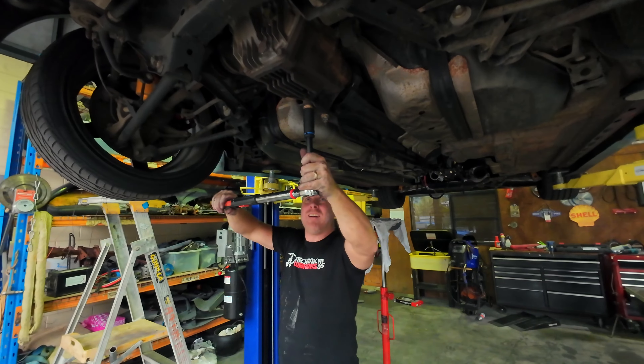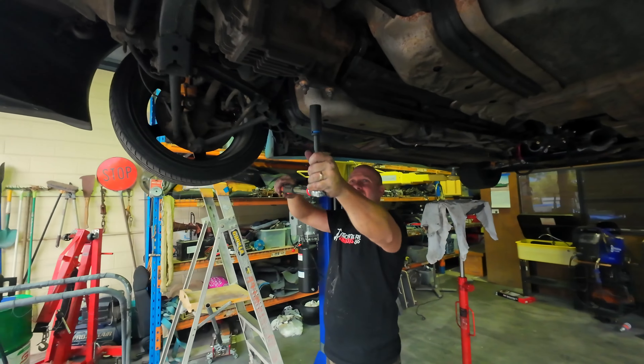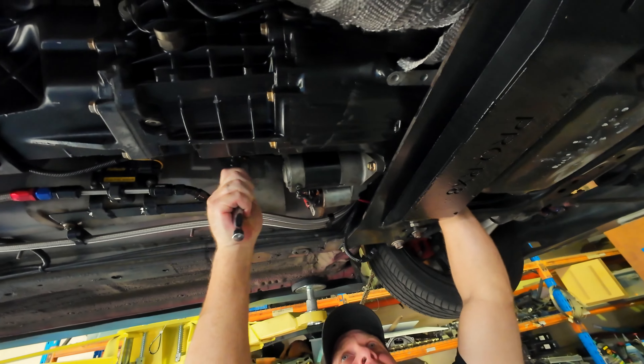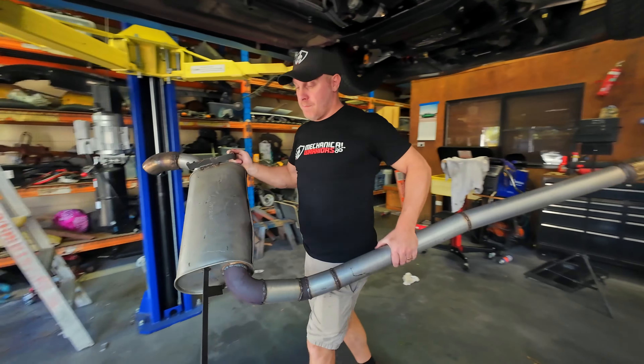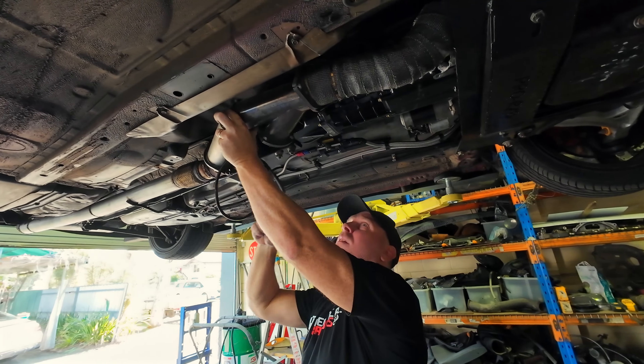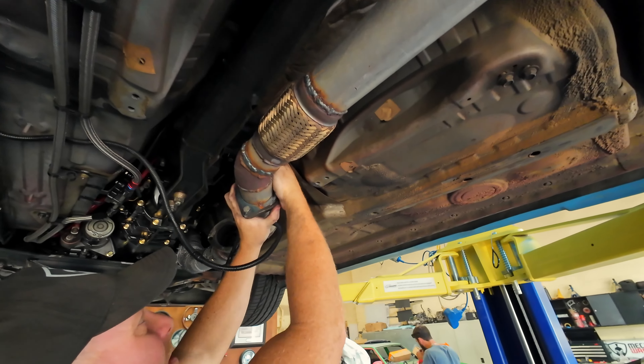Next, it's time to put the gearbox into the car. With the help of a jack stand I carefully raised the gearbox to match the engine. Remember to remove the alignment tool from the clutch before doing this. Make sure the gearbox bell housing slides right up to the engine block — do not try to use bolts to lever the box into position as you can destroy both the gearbox and the clutch in one hit. I then installed the tailshaft, connecting beam, starter motor, and all the wiring, then fitted the exhaust system with all rubber mounts and the dump valve.